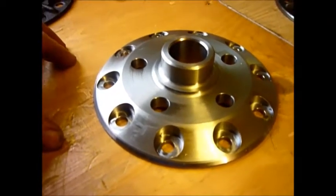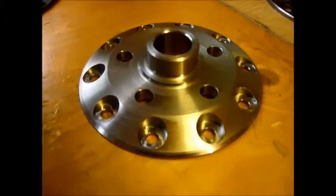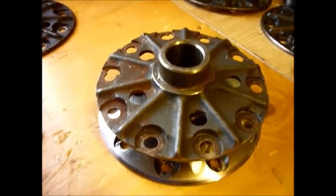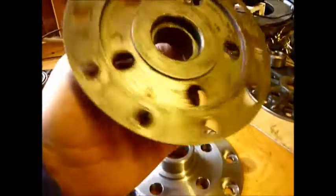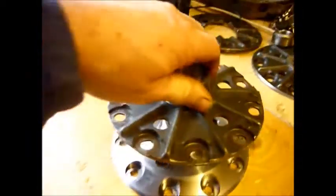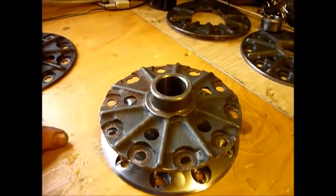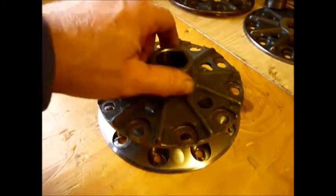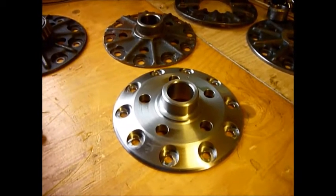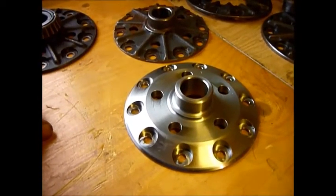The rest of this video is actually showing you one being built onto an early RD03. This is nothing unusual - this is fairly typical of a very worn, very tired end flange. The rest of the diff is perfectly serviceable but being an RD03 you couldn't get that part, so the diff was scrap. So we'll now look at actually fitting the new unit to one of those differentials. These are available off our website - there is no difference between the RD56 or the RD03 fitting; we've made it so it fits both models.